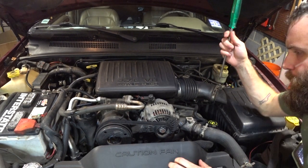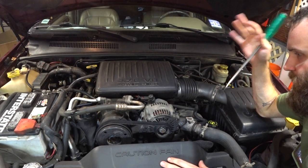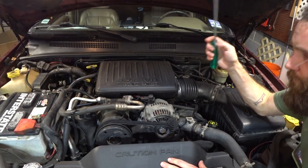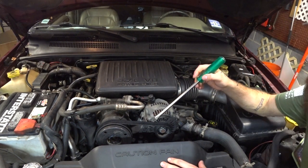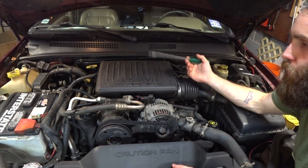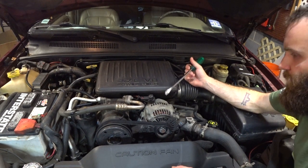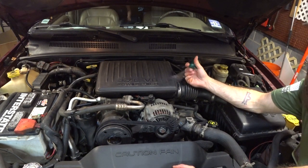All right, now let's recap everything we've discussed. Basically, these things go sour because of a lack of understanding, some good old-fashioned American ignorance, right? You don't know that you need to line up that thermostat just right. So now you've got a very slow seeping leak, which leads to a low coolant situation. If you go back to sixth grade physics, liquids cool better than air. So if you have a big air pocket in your Jeep, you're not gonna be cooling as well as you should.